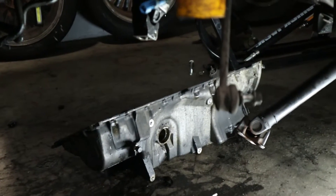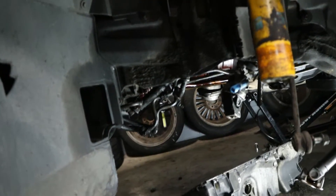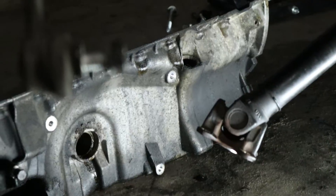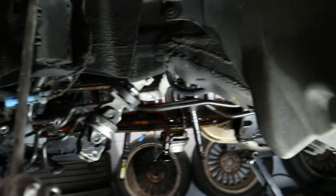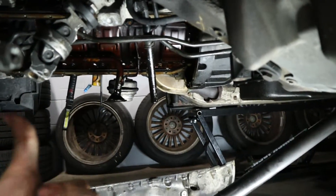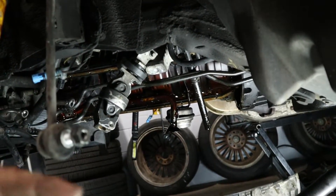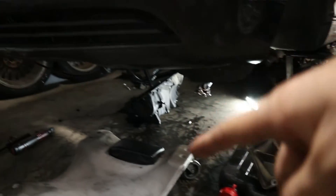Just like that, with a whole day's work, we've got the oil pan out. It gave me a little trouble at the end — I had to pull off the three bolts holding the power steering pump because it was too close to the oil pan, but once we did that it came down pretty easily. The dipstick tube is super long so it won't be fun to install. Don't forget the three bolts that hold the transmission to the oil pan — they're torqued and facing a specific way. All the other pan bolts are 10 millimeter steel bolts — reuse them, don't lose any, and note there are a couple of different length ones so don't mix them up.